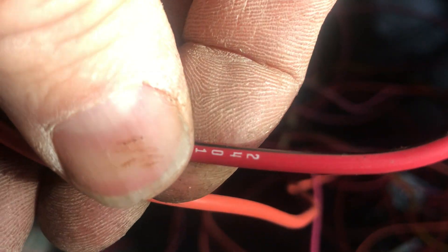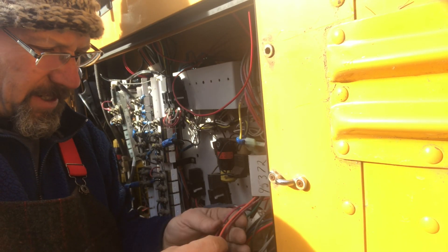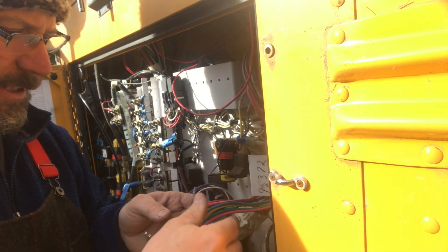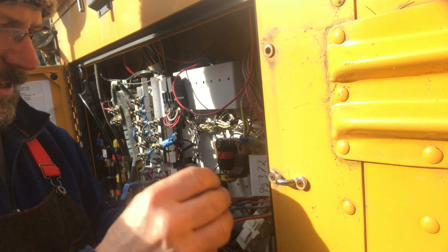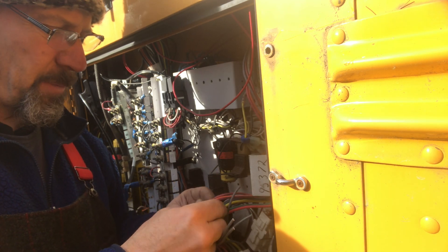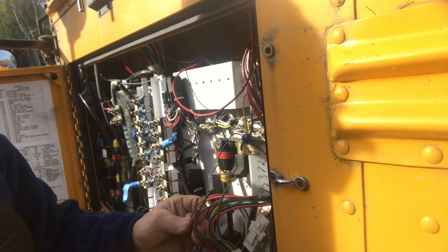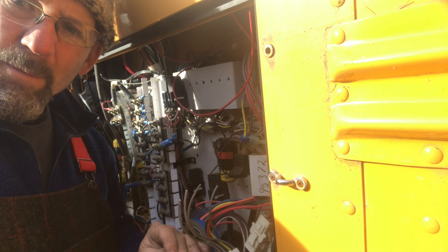We're pulling these wires back to the panel, and the good news is we've got the numbers here on the wires. I've traced the wires back through here — they have the same numbers on them and go into this wiring harness. But I can't really unplug the entire wiring harness because these four wires go back to the brake lights and things. So I'm going to clip these off here, label them, put some duct tape over them now, but then go back and shrink wrap them later on. I'll pull those wires back up off the top and then restart the bus again to make sure everything runs.